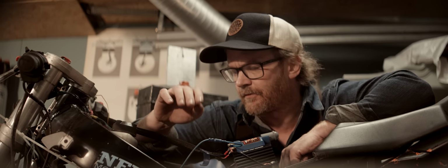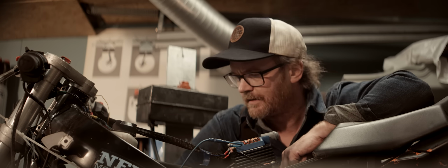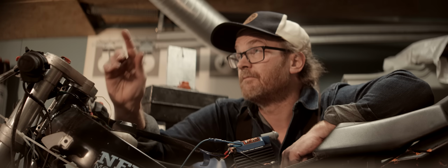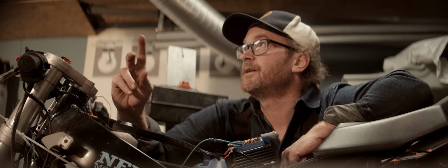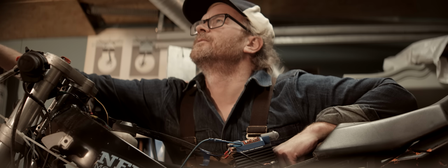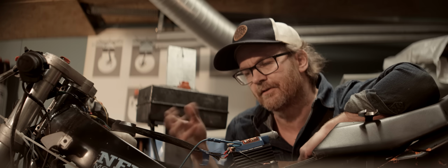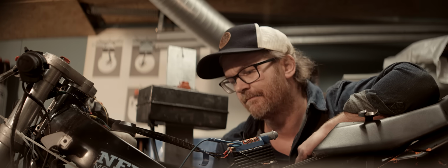It started running away from me, wouldn't shut off with the kill switch, and then it died. And I'm pretty sure the plug is melted. And we didn't spray much nitromethane. We saw maybe 1 horsepower increase there. Let's see here. Maybe 0.5 horsepower, something like that. It might mean the perfect AFR on gas is mixing with the nitro in the crankcase, and then it turns out to a super lean nitro mix.